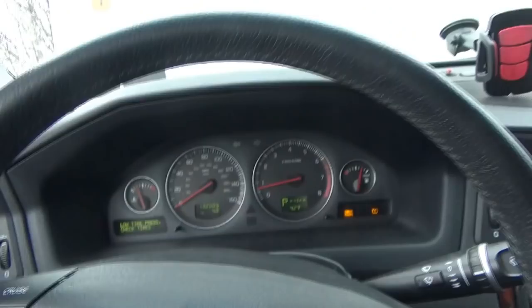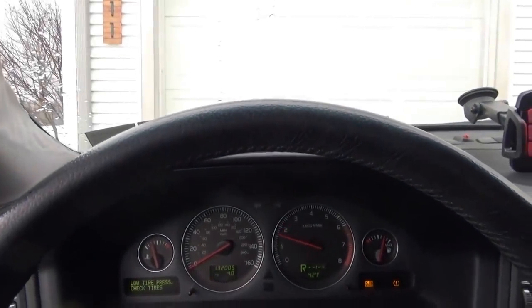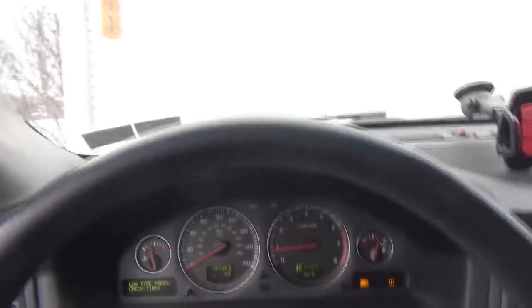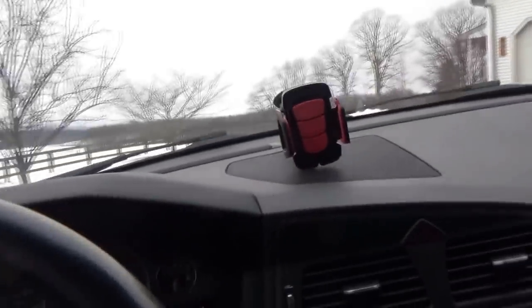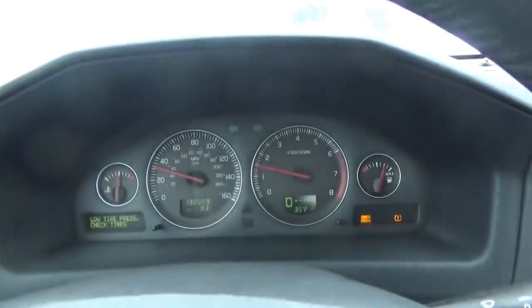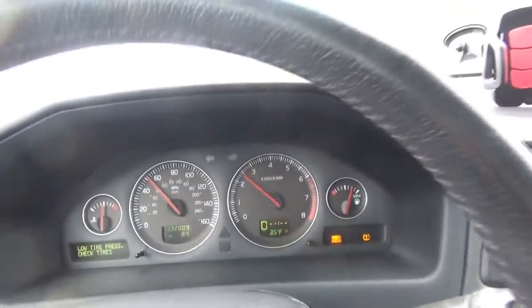We can take it for a test drive. The car is actually driving pretty well — still got boost, amazing — it just has that little turbo sound. But at idle it does shake. Cylinder number one compression is not as good as it used to be. Worst case, the engine has to come apart to fix it properly. We'll talk to the owner and see what he wants to do — keep driving it for now, or eventually trade it in.